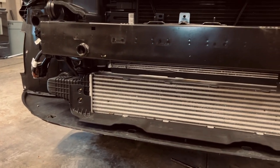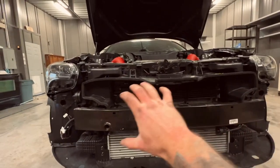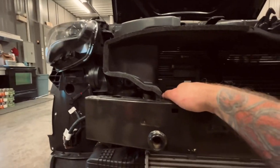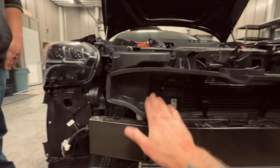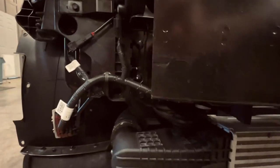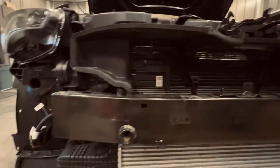Nice and conservative small intercooler — we're going to be replacing this. I wish I had an intercooler right now; this would be the perfect time to install it. We're unfortunately going to have to redo this all over again during the spring when temperatures start rising. Let's study this air intake system: we have our bumper on, the air is hitting the intercooler and radiator. This looks like a transmission cooler or oil cooler. I don't see good airflow up into the engine bay — I think the air is hitting this shroud here. Are you kidding me? They're expecting the air to come up in here and then travel over this and then go in there? This is not a good design for performance at all.